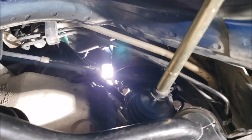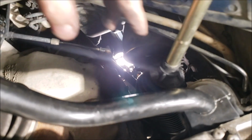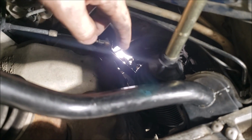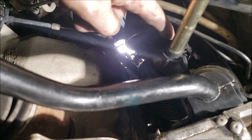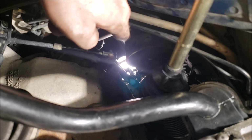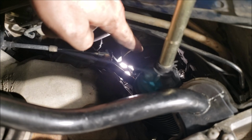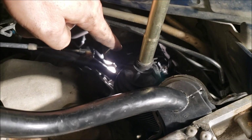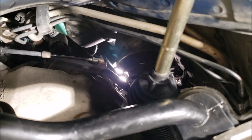Now, seeing as though you had your steering wheel straight from the start, preferably locked, but you don't have to lock it. What we consider straight and what the rebuilders consider straight's not perfect. I was able to just turn the universal joint with my fingers, and it can only line up one way because you're going to have 2 flat spots, and then the one side where the 11mm bolt goes through, and that's got the notch on the shaft. So seeing as though your steering wheel isn't a full turn or 2 turns out of rotation, you're going to be fine. It's actually much, much easier than spline setups that I've done on other vehicles.